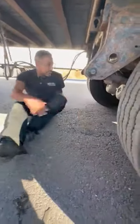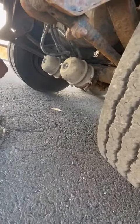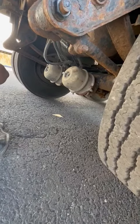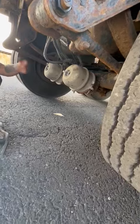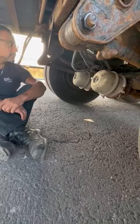You have your brake chambers here. You want to make sure your brake chambers — your clamps are tight and secured, and the brake chambers themselves are not cracked or broken. No audible air leaks. Check all your airlines for no abrasions, bulges, or cuts. And again, no audible air leaks.